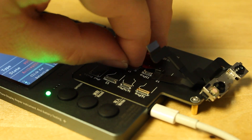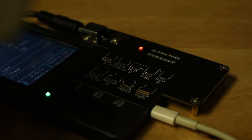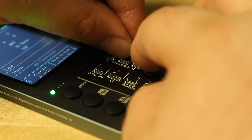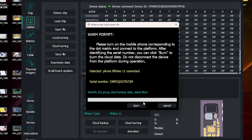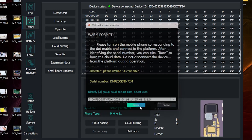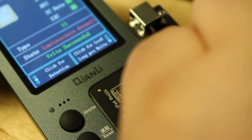Now that it's been activated, we can disconnect the dot projector. We'll get our new Tag-On Face ID flex cable for the iPhone 11. We'll hit cloud burning, select the most recent file, double check it, and hit burn. It'll go through the process and it's successful. We now have success confirmed on both the computer and the programmer. We'll disconnect.